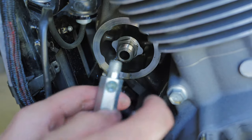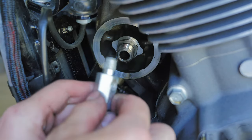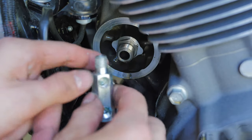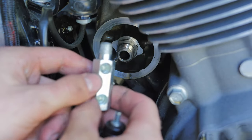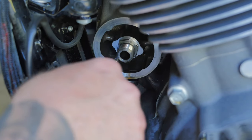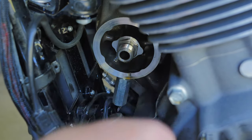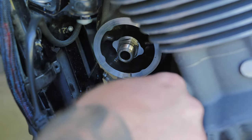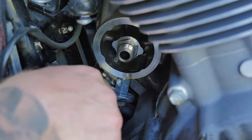I'm going to apply this adapter, and I'm going to apply some thread sealant to the top of the thread. Just keep in mind that this is a tapered thread, so if you crank down too hard on it, it's going to crack that housing. This is making me pretty nervous — I can feel it getting really tight, so certainly don't want to do one more revolution as it will crack that thread.